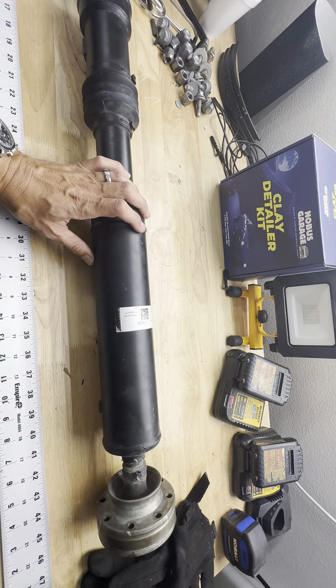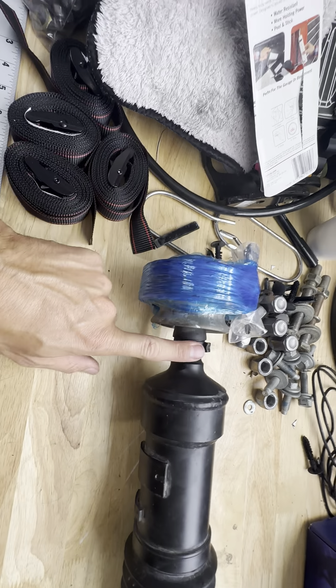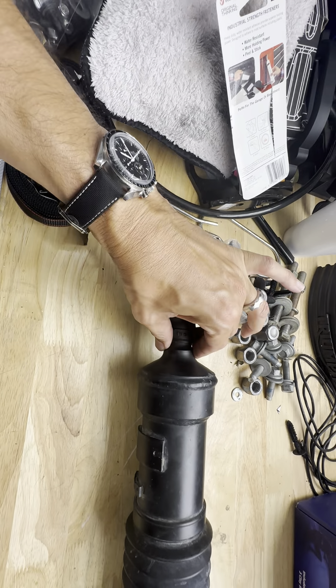The other time was out at Cougar Buttes — that was the rear driveshaft on 37s. Then there was one on the Rubicon with 38-inch tires that just twisted off. The other front driveshaft was a 1310 double cardan shaft I had built, out at Cougar Buttes. That one snapped right where the tube gets thinner connecting to the yokes — it was too short on the slip yoke, too small for the rig that was already on 40s and one-tons.